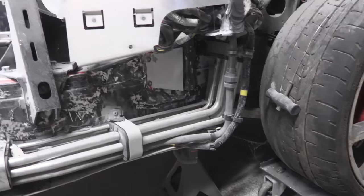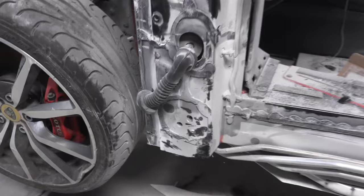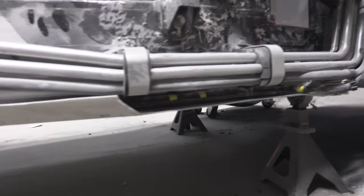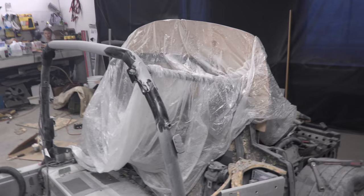That went pretty well. I got everything from that bottom side of the panel going all the way across the side part of the panel, leading up this side rail, and got the windshield rail all done, even all the way up to the top, and cleaned that part off. So in 2 hours, I was able to get all that done, minus this bottom piece of fiberglass. So I'm gonna have to come back and take that off after I jump back on here and lay up one more layer of fiberglass.